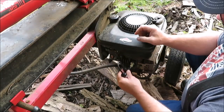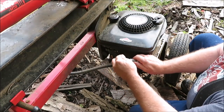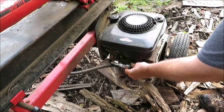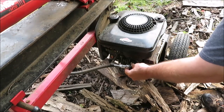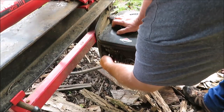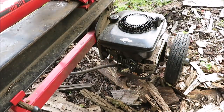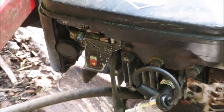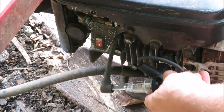You're just basically going to plug this onto your spark plug. This piece here, you're going to plug into this side, and then you're going to pull your cord and look for the light. And as we can see, we have no light lighting up. Now that doesn't always mean that the coil is bad. You have a little shutoff switch right down here. Let me show you a shutoff. I'll show you that this doesn't have any spark on it.